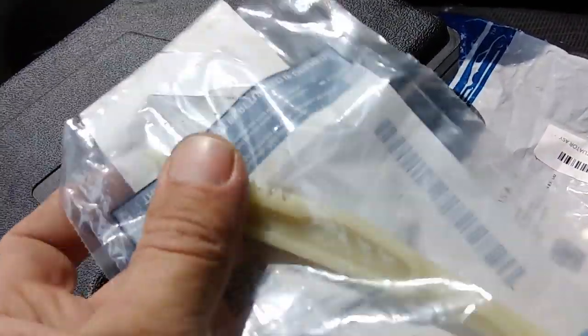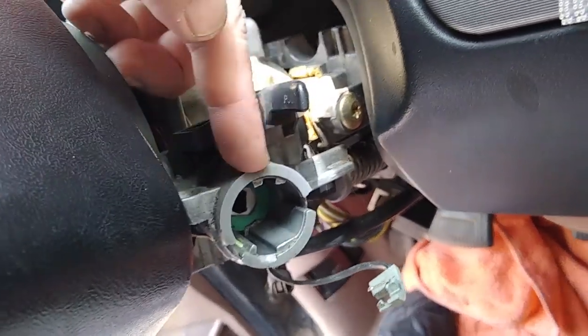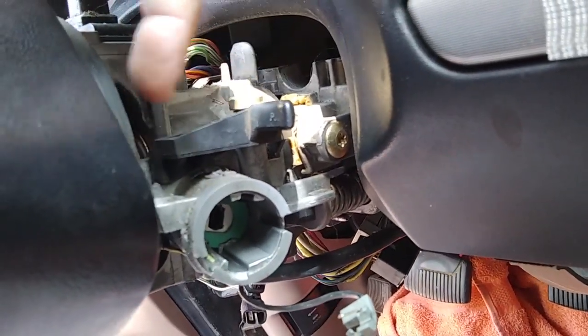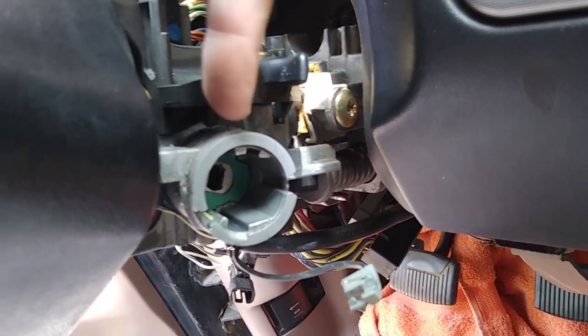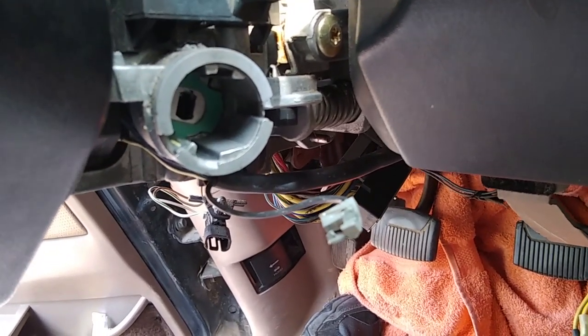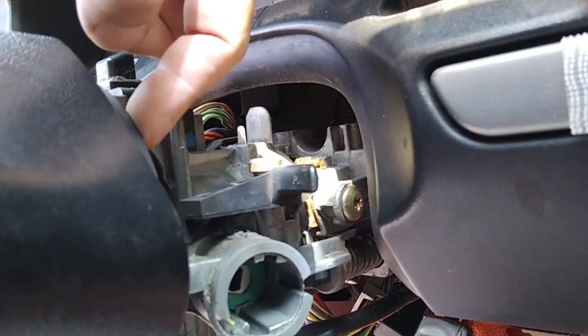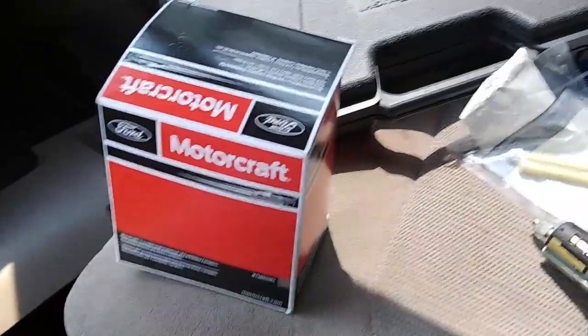This is the piece that goes, see these gears here are what are located inside of the steering column here. So if you look at this steering column, that gear goes in and out when you turn the key here, when the steering lock is normal, or the key lock is normally in here when you turn it. It actuates that plastic rod, which moves in and out. That gear moves the rod in and out, which pushes on the ignition box right there.